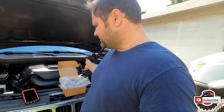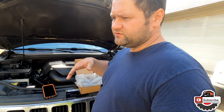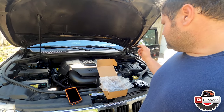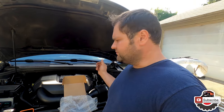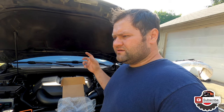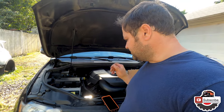This particular pump that I have on this Jeep goes from 2011 Jeep Grand Cherokee all the way up to 2015 Jeep Grand Cherokee on the 3.6 Pentastars, the V6 versions of this engine. And I know that some of the Wranglers also run the same motor, so it might fit - I would just contact them directly with the sticker off your AC with the part number, just to see if it will go. Most likely it will fit, but I would double check and go from there.